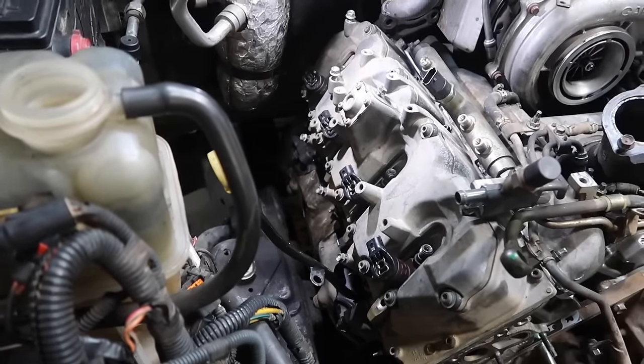As you can see, we got a couple of high pressure lines on here. One good practice when disassembling, make sure you lay these out in order. Hopefully you guys did. We're just going to go ahead, pretty self-explanatory, putting the line back on there. Basically just thread it on and you'll be good to go. One thing I do stress is make sure you make these very tight. You don't want them to leak fuel all over the place or have an issue down the road with cranking.